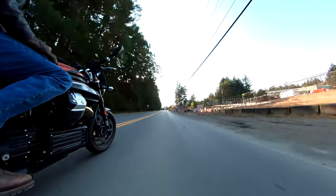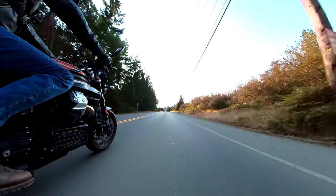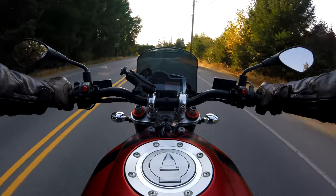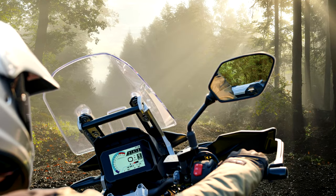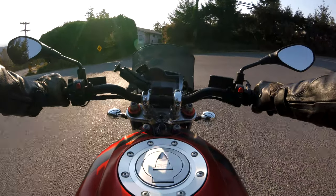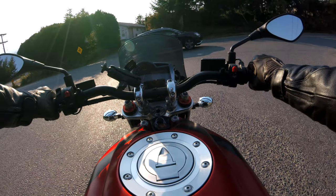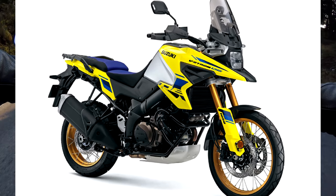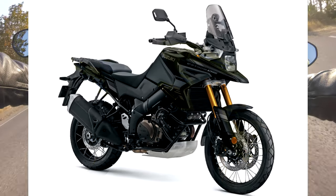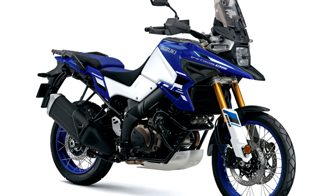Just as importantly, though, it's what you can't see that also makes this a bona fide member of the ADV off-road big bike club. It now has switchable rear ABS, meaning you can now turn it off without pulling a fuse. An included gravel traction control mode, which retards ignition timing, allowing for limited rear wheel slip off-road, as well as three other traction control modes. Motion Track brake system, which uses the six-axis IMU to determine lean, pitch, and load-dependent brake pressure adjustment. A hill holder system, slope-dependent braking to allow confident downhill front and rear brake applications.